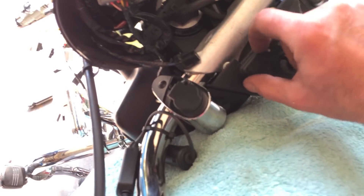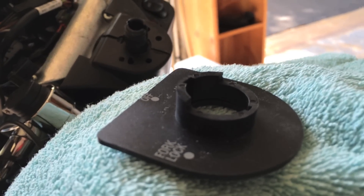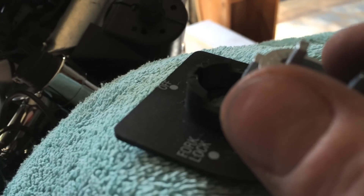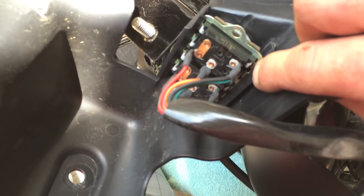This will probably slide up as well with a spacer. You want to keep track of which way they go — there's a lip that rises up on this at the top edge, and you'll lose that orientation once it comes off. Keep that in mind. Same thing with this: when it's on there, that tab goes towards the front edge too. Once you slide this off, it looks like these connectors are all held in by one big channel clip. If I pry this back, I should just be able to pull the switches out. The cruise is on the left and accessories is on the right.